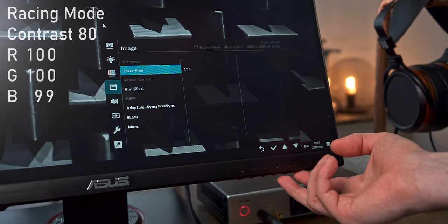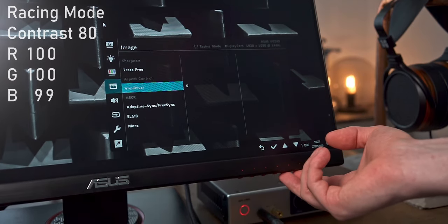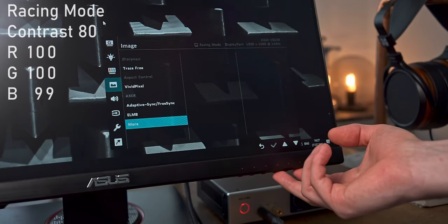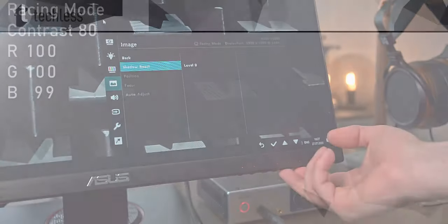You can download the ICC profile from the link in the video description. Make sure to dial in the same settings, and as always, this is not a substitute for an individual calibration and profiling. With that profile applied, the VG249Q measured an excellent average delta E of 0.14 with a maximum of 1.33. The recommended thresholds are below 1 for the average and below 3 for the maximum delta E, so the ASUS can be calibrated very accurately.